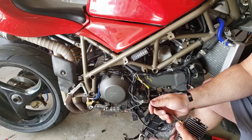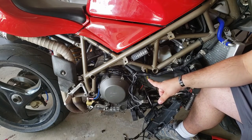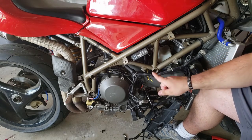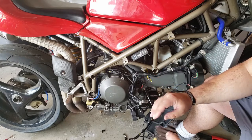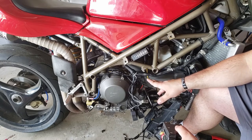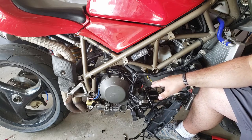So what I've checked with the unregulated voltage check is, on the other end of these two yellow wires, this is the dead one, by the way, I measured the alternating current coming out of the yellow wires. I've also unspooled them. Earlier on, you would have seen this all wrapped up in tape that was just crumbling apart. Previously, I checked for continuity on these wires, and I checked to make sure that nothing was grounded, and nothing is grounded. The continuity is fine. The resistance is a tiny bit higher than it should be, but it's so close, it should be doing something. You basically stick the prongs in and measure the alternating current going between here.